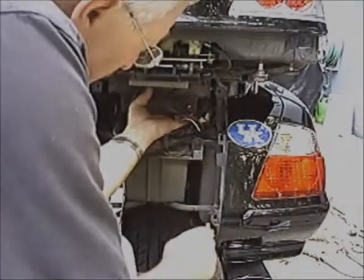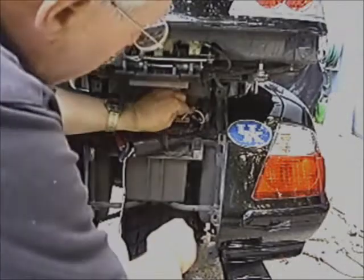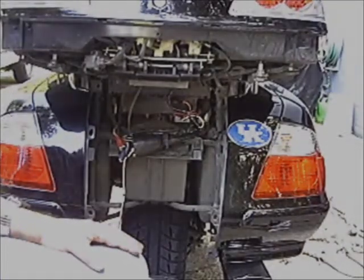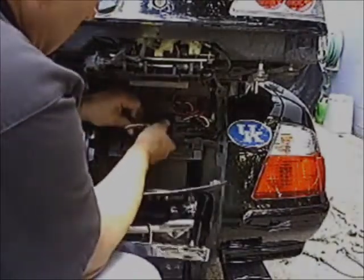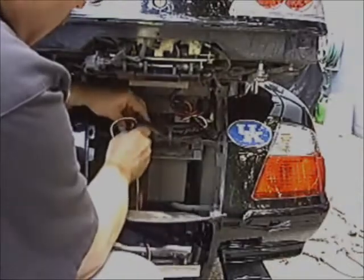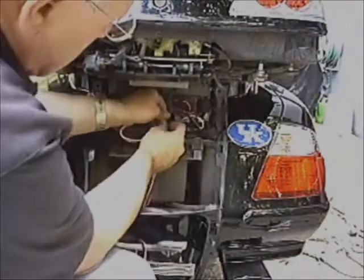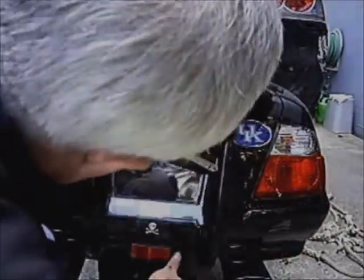I've got the unused wire taped up and won't be used. All other wires are taped up, covered, and all my splices are covered. I've got the Starbrite liquid electrical tape gooped up on everything. Now I'm going to put the rear fender cover on, shove these connectors back up in, protect them with the boot — Honda provides these nice boots — and then tie and run the connector down good and snug and put my fender back on.